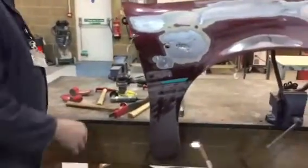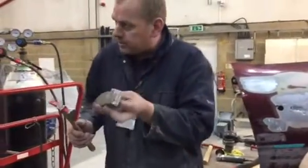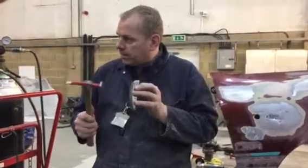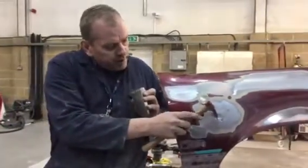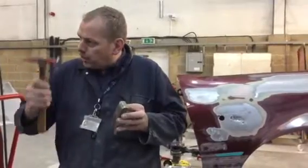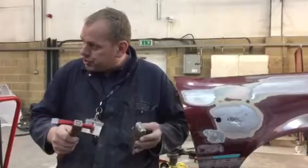I'm going to get my hand weight for shrinking — this is the toe dolly — and put it behind the panel. I'm going to use this hammer to not dent out. I'm going to get a little cherry red spot in the middle, push pressure on the back, smack it in the middle of the spot, and then work around it to manipulate the metal a bit.